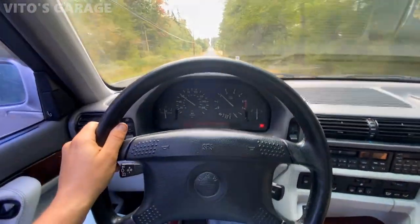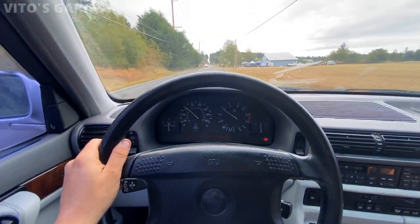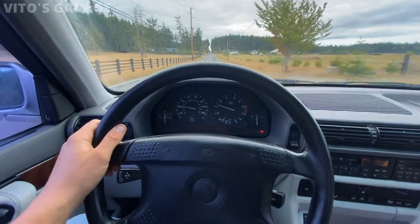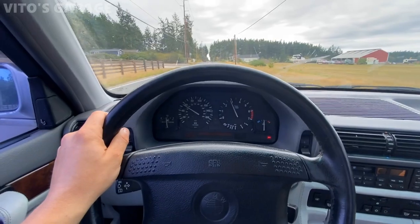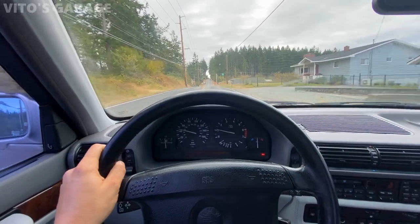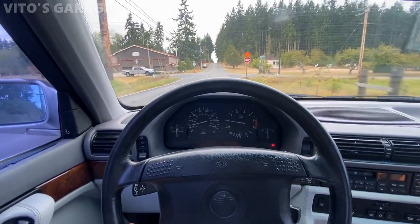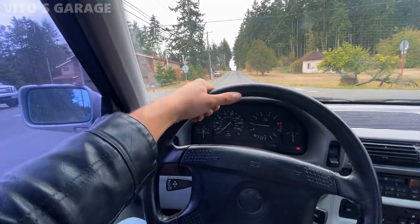That feels like from the rear? Could be front or rear. Hard to say, but it goes away at around 60. It could be a tire balance issue, or we have mismatched tires as well. Fronts are 17 inch and rears are, you know. Amazing! What an amazing car! Oh, nice. Back to life. Yeah, feels good. But definitely gonna have to do those tires.